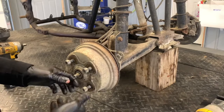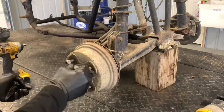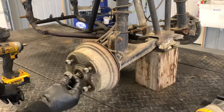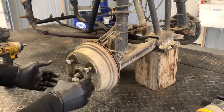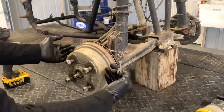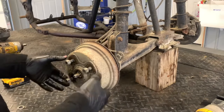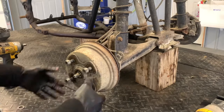Typically these aren't very difficult to pull off. The torque spec isn't very high because you've got that keeper running through it — that cotter pin is what keeps the nut from coming off. If you put the nut on and forget the keeper, the nut will work itself off and your wheel and tire will eventually just come off. Make sure you've got that cotter pin in there.